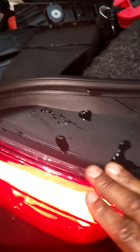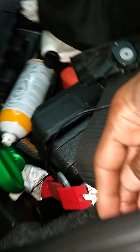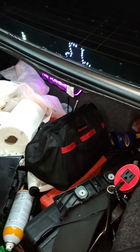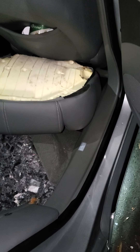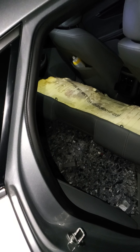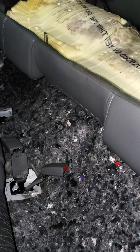These lights right here — the gaskets behind them go bad. The factory ones go bad too. When that gasket goes bad, water in the trunk runs right down to your floor. It's full of water, and when you hit the brakes, it gets all in your car — total disaster. Thank God I caught it. It took a while — five or six months. I kept spraying my car trying to figure out what the smell was. Everything in the trunk had a mist on it — it was wet and moist and I could never figure that out. I never thought those lights would leak water in like that.